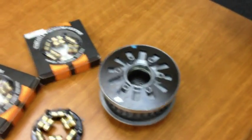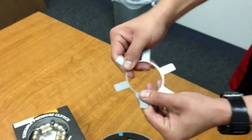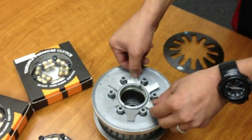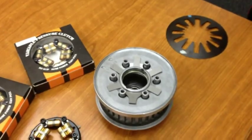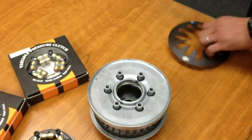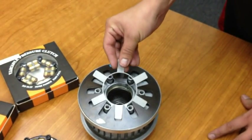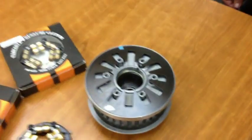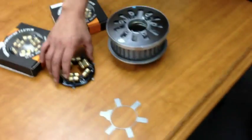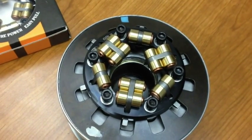AIM, we're here showing you how to install a VP clutch on the motorcycle. Here is our shim that we need to manipulate into a concave position. Remove the spring, install the shim on the pressure plate, then put the spring on the pressure plate with the shim behind the spring prongs, making sure it's lined up where the holes are open. Take the VP, install it, and fasten the screws.